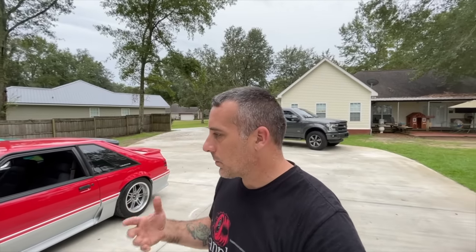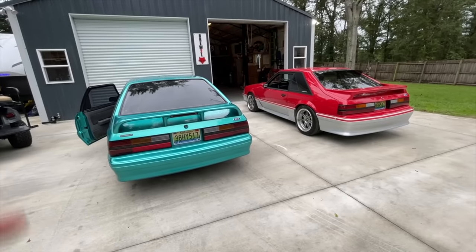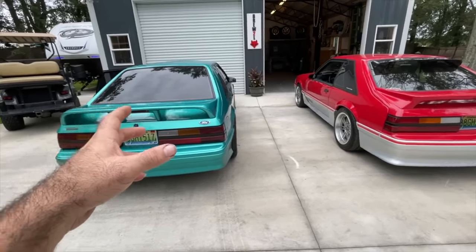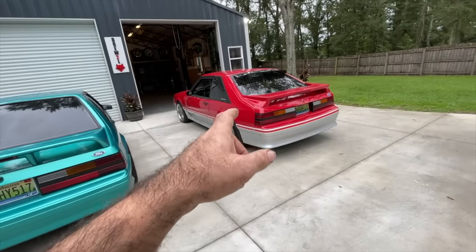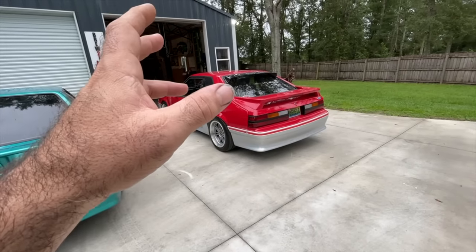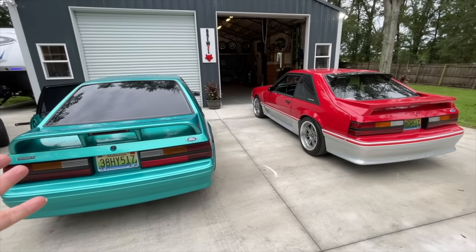As you can see guys, that is a huge difference. This thing sounds so much deeper and just sounds more airy — that's always the expression I use when I'm trying to explain something like this with big heads and a big cam. I know this is a B cam, but I think this is the sound I was looking for. Sounds freaking awesome. It has so much bass in it that the camera just tries to block it out. So before we end the video, I want to start both cars up for you guys and let you hear both because they sound very unique. This car is a 347 Comp Extreme Energy XE 274HR camshaft with a turbo and the Borla XS mufflers. This car is a stock 302 bottom end with a B cam, SVE 170cc heads, and the Jones mufflers. Both have the same turndowns.